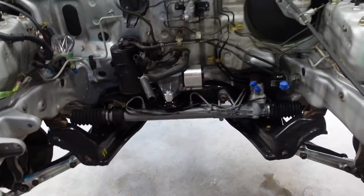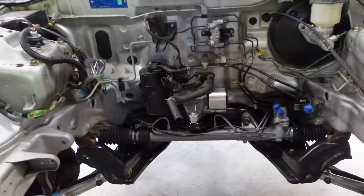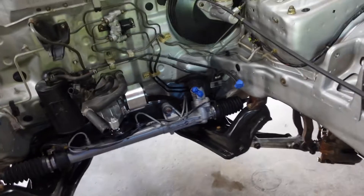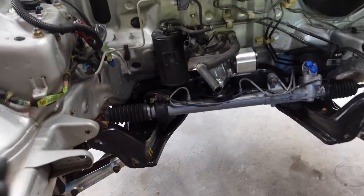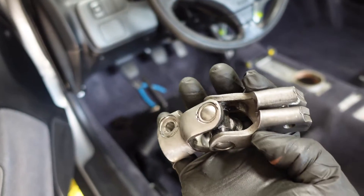Alright, so I got the subframe back in. Unfortunately, was not able to get the rack hooked back up to the steering wheel because we have to get a steering column knuckle from a DC2 Integra. Got the PLM rigid collar kit on with no issues — unfortunately their website doesn't have any instructions, but I used the Blox rigid collar kit instructions and was able to do it just from the photo. Everything is all bolted up though — the power steering rack, everything fits as it should. Taped off the ports so no debris gets inside. Gonna have to make a junkyard run to get the steering knuckle from an Integra. It's pretty easy to get to — it's just right there — but you gotta have the right parts. I'm going to close out the video here. Thanks for watching, take it easy. I'm out.